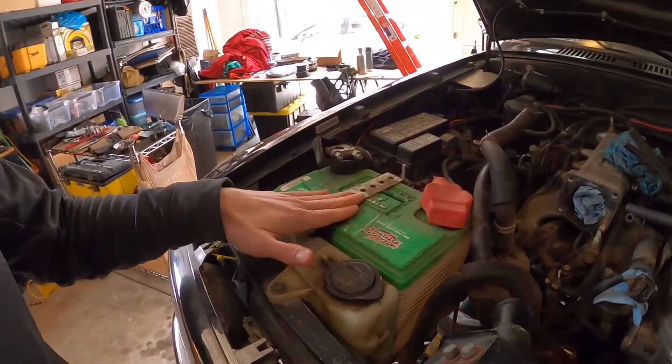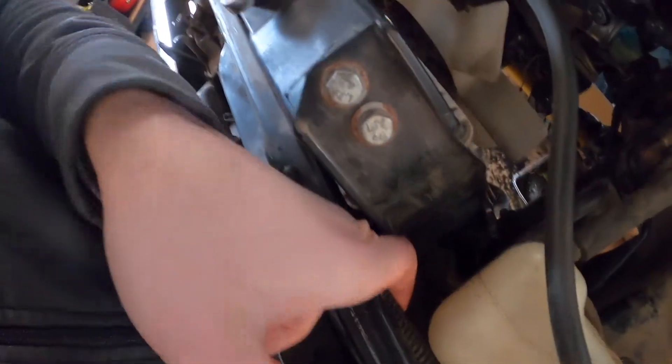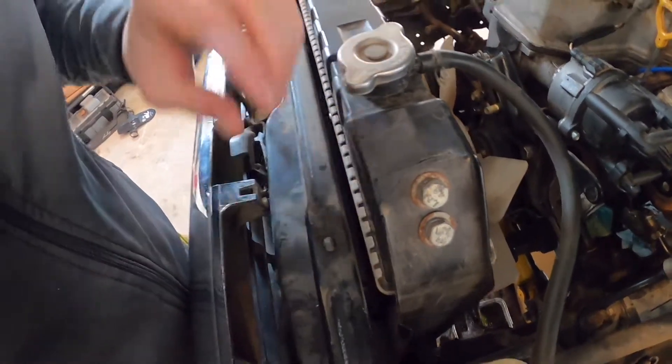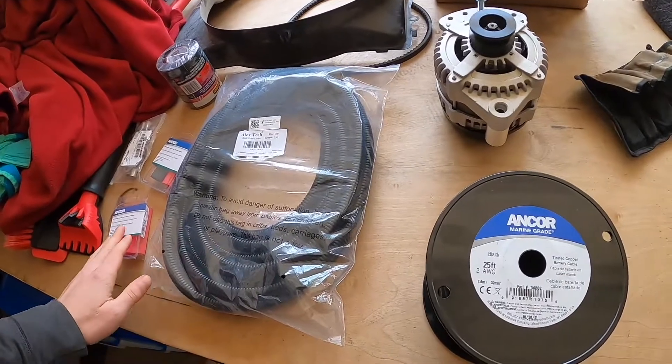I went with two-gauge because it is a little bit longer of a run — you can see the alternator position is on the driver's side of the engine, but we have our battery over here. The factory wiring ends up running behind — you can see this wire loom right here, that's the charge wire that goes to the positive terminal of the battery. I may have to remove the radiator to get in there, which isn't a big deal, it's only a few bolts. I've got the fluid out of it already. I want to tie everything up nicely and make sure I do everything properly. I'm no auto mechanic by the way, so this is not a how-to by any stretch of the imagination.